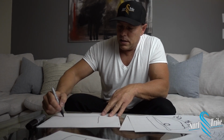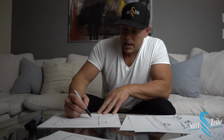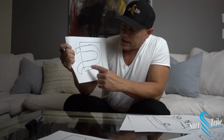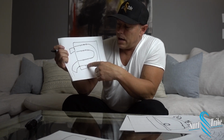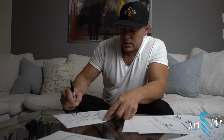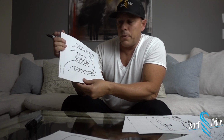On the inside of the Fab Speed ones, let's see, their muffler, the high flow one, it comes in and basically just goes in a big circle, and there are holes in 2 spots on it because I looked in it with the scope. The one set of high flow ones looks like this. So the exhaust comes in and goes straight through. It's a nice curve. So I imagine these are going to be a lot louder than mine. With the perforations here, the sound can bounce into here a little bit, but this whole case is full of packing to keep it a little quieter. So when you look in there, you can hardly see into the little holes looking up into it. So it's pretty well packed in.